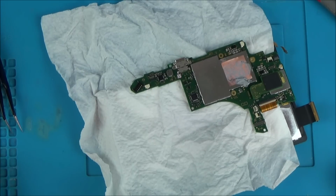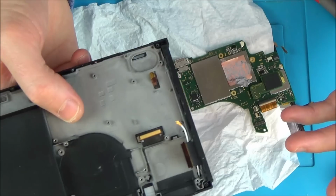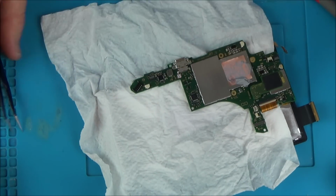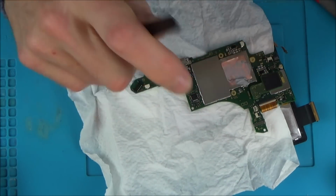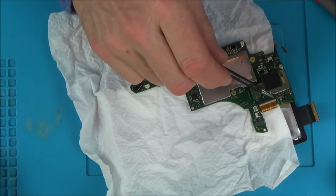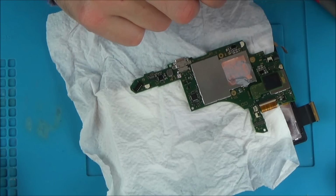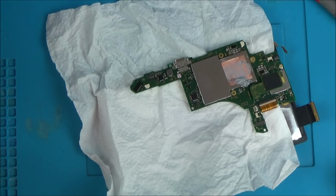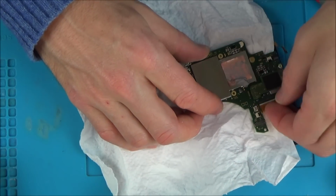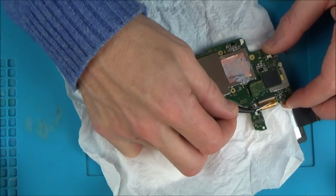Right, do you know what I'm going to do? I am going to put it in this case here, and I'm going to leave the screen disconnected, and I'm going to dock it to see if the switch itself works without the screen connected, because it will give me a bit more info to go on. But it's confusing me now why the short goes when I connect up that. Does that mean that this chip is faulty still, or does it mean that it's something else that's causing the fault? So obviously when the pins go through to the screen, they're coming back and they're causing a short, but it's not the screen that's causing it. It's something else. That's a bit of a shame. I thought it might be just a screen. But it certainly makes it more interesting. It just means that there'd be less chance of me fixing it, less chance of me proving what the fault is.